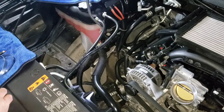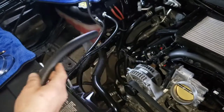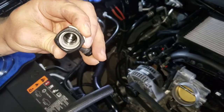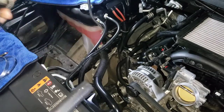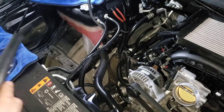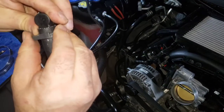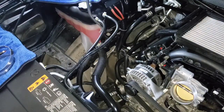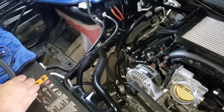These new hoses that come with the kit don't have the quick connects — factory style — where you just depress these to take it off. I'm taking them off my other intake because I don't feel like using those small ring clamps. Pretty simple to do: just open these up, slide them on, squeeze them together, give it an extra click, and then you've got factory style clamps. So that's that.